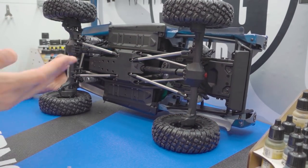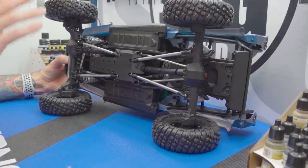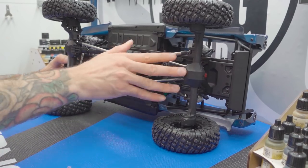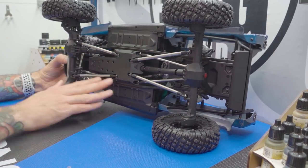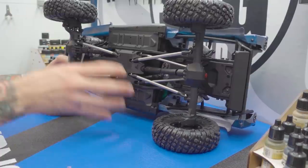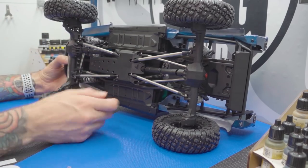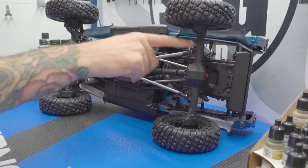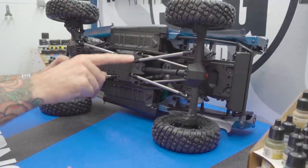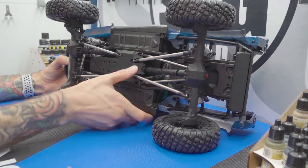Okay, so moving on from the axles, next up we've got stainless steel links throughout: steering, drag link, panhard. They're all stainless steel construction, very strong, very beefy, and do a great job of getting yourself slid over an obstacle rather than hooking up on it. I do like that they do stainless and not just an aluminum link, because I do think it also brings a little bit more weight down low. Stainless steel pivot balls throughout as well. Every single contact point between a link and another part does have these stainless steel pivot balls, so also great to see that.